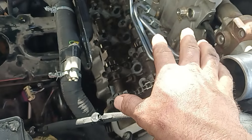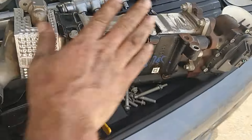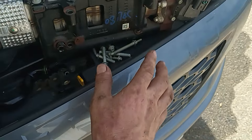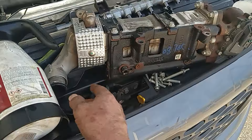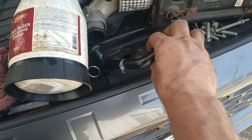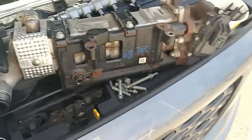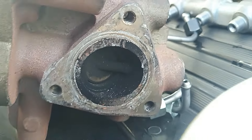To get the valve cover off, you need to pull the EGR off. It's two bolts up top and two bolts down bottom. You've got some electronic things you'll have to unplug. It's just O-rings here and here and somewhere else. You've got your pipes — they've got to come off. It pops off pretty easy, and then you've got your three bolts on the back for your EGR — they're back here.